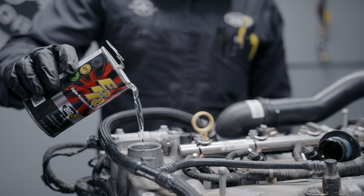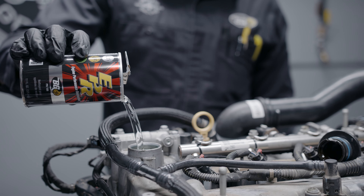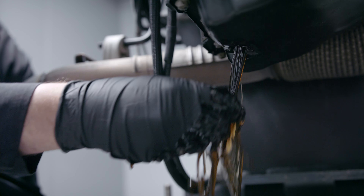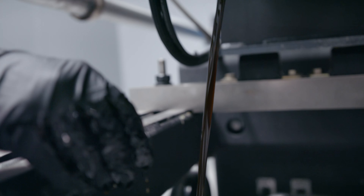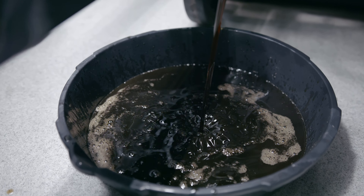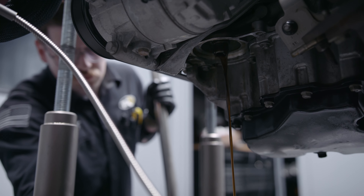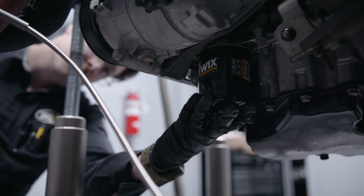After that service, we install EPR into the oil. This goes into the old oil and is run at 1,200 to 1,500 RPM for 20 minutes. EPR helps to clean deposits inside the engine and suspends them in the oil before draining it out. After EPR has had its time to clean, we drain the old oil out and replace the filter.